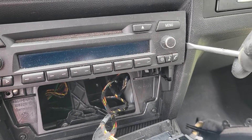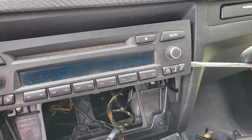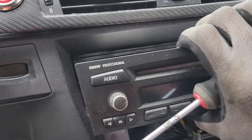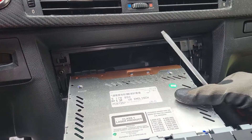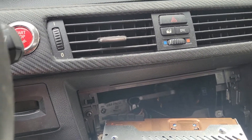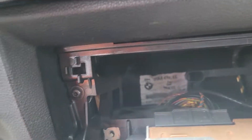You can come in on the edge or even from the bottom — I would use the edge. This is where it's important not to mar up your dash. Get in behind it and pry just a little from both sides and your whole radio unit will slide right out. It should be noted that you do not have very much slack behind it to work with.